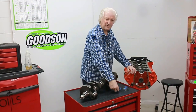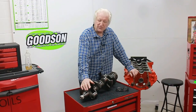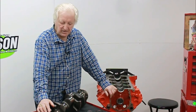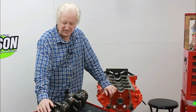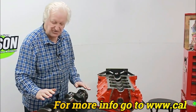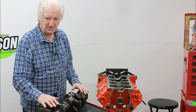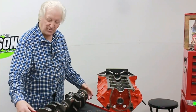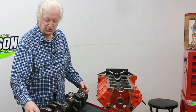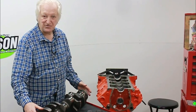What am I using for a crank for this 401-inch small block Chevy? In this particular instance, the 3.875 stroke crank I'm using is from Callies — one of their CompStar cranks, not their most expensive. What I like about it is hollow journals and counterweights designed so that internal balancing is an easy job. Internally balanced means you can balance the crank without a flywheel and damper carrying out-of-balance weights, so an internally balanced engine doesn't require an out-of-balance flywheel and damper.